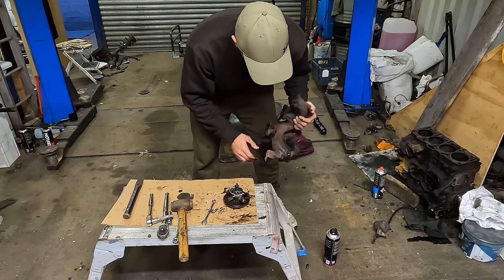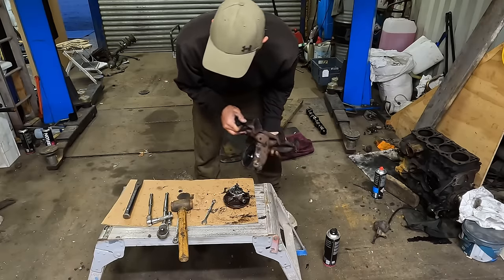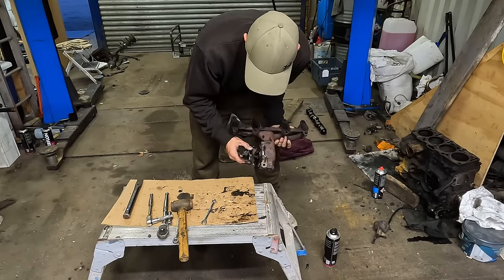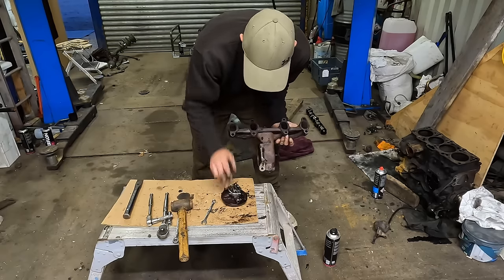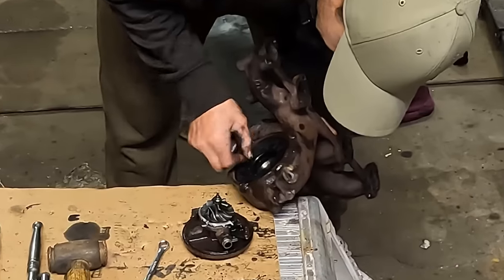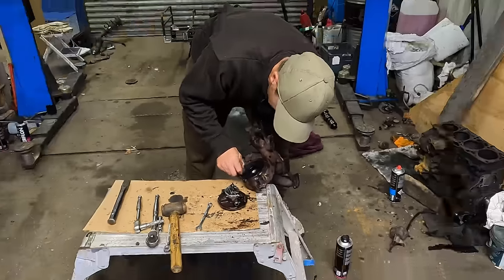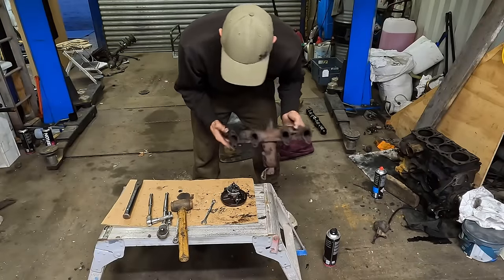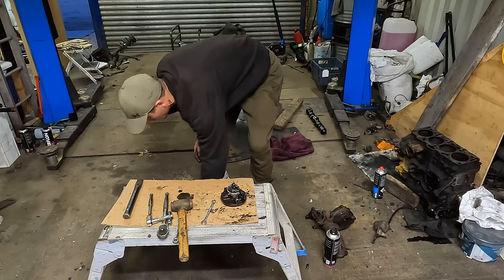Anyway, so I'm going to quickly clean this up. I'm going to find the VNT parts, and then literally, that's the turbo in there. Other bit on. Bosh. I'm going to clean it out. This is your VNT. Need to make sure they all fully move before we assemble. Clean it up. Clean out in there, and we'll assemble. Thought that was going to break. Happy